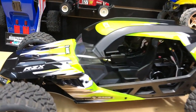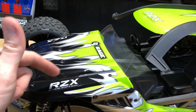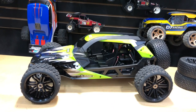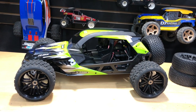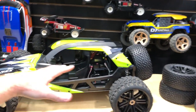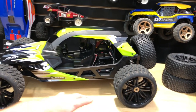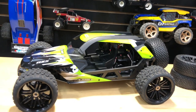Being this is the Rage RZX — I always want to say CRX because I'm so used to Honda stuff — this is an extreme sport buggy, and it's definitely extreme when it comes to the power. Some of you were saying it's not gonna put the power down, but it does wheelies too, just on drive surface, no issues. The problem is stopping — when you start to go, power transfers to the rear, which already has a lot of weight. Just like a rear-wheel-drive car, when you accelerate the weight shifts to the rear.